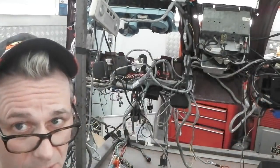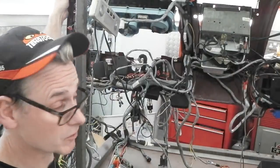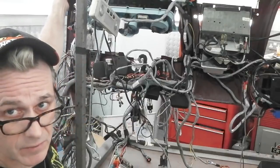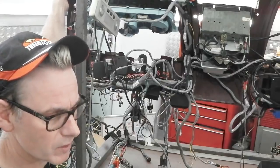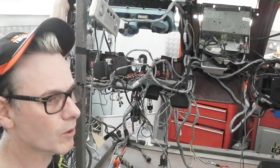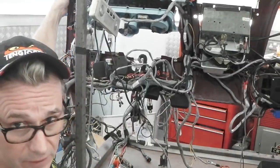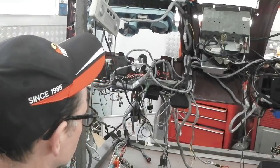You don't have to have them. If I press down on the headlamp switch, which is in the off position at the moment, but if I go down, back up, it deactivates that system till you repower the car up. So if you didn't want them on for any reason, stealth reasons, battery saving reasons, whatever it was, you can kill the automatic lights with a quick click down on your light switch, and that gets rid of those.